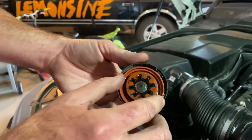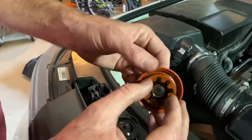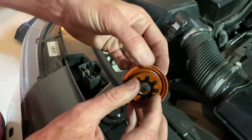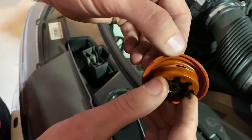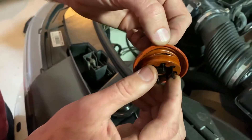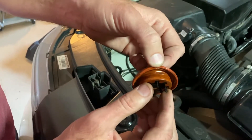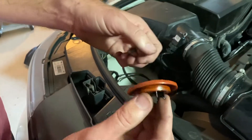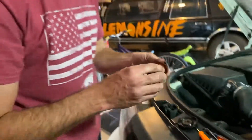Here is the actual rubber piece that goes inside the cap — it's pushed against a spring. When this breaks down you'll see a little tear in it; this rubber gets tired over time. Right here there's the split in the rubber piece. This is not just talking to you — it's actually saying 'I'm sucking in air, replace me.' Once you replace it — they're about $30 online — snap the new one in and hopefully your lean conditions will go away. Hope this helps and good luck trying to reach this.